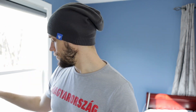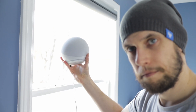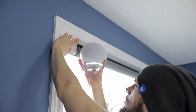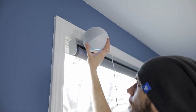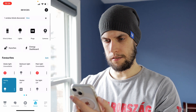Step one: you can unplug the repeater — you're not gonna need this for now. Step two: reset the blind. Then we're gonna start a new device discovery on the Echo. If you can move your Echo close to the blind, that's perfect, or just take the blind off the brackets and move it close to your Echo. As we hold down the two buttons on the blind, we start a device discovery — 'Starting discovery.' And it found the first device!